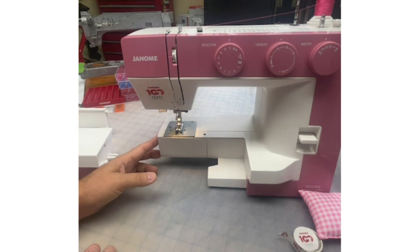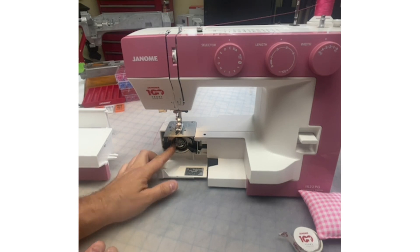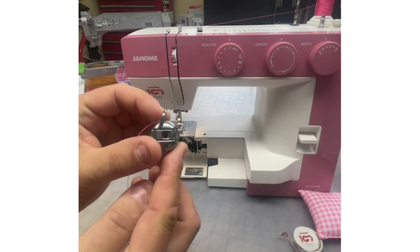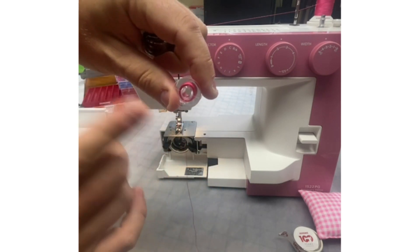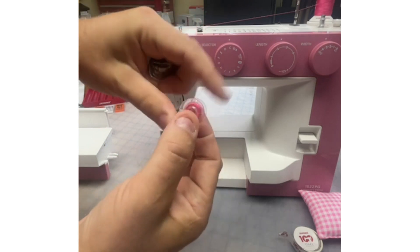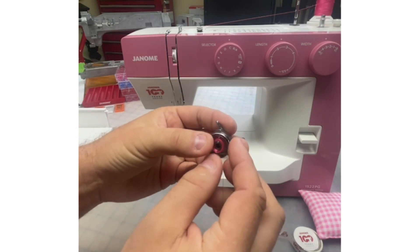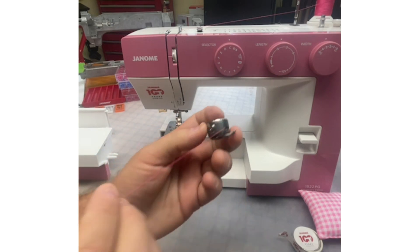While I have this cover removed, I'll show you our oscillating bobbin holder and bobbin case. The machine is oscillating, which means it's vertical, with a separate metal bobbin case — much like our industrial machines and long-arm machines. For our oscillating hooks, we want the thread to come off clockwise — the opposite of the lay-in kind. Put it in the bobbin case through that little notch, and super simple — boom, it's done.